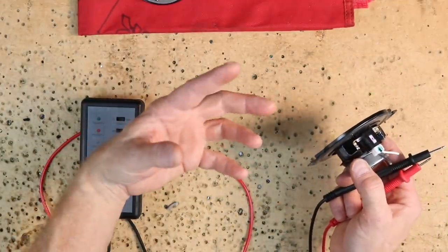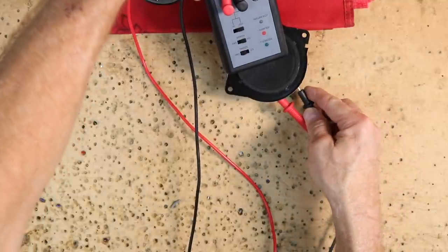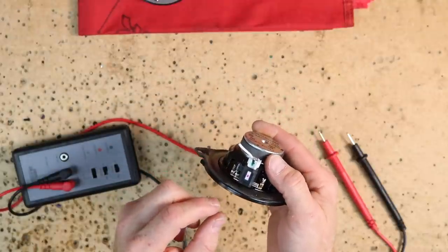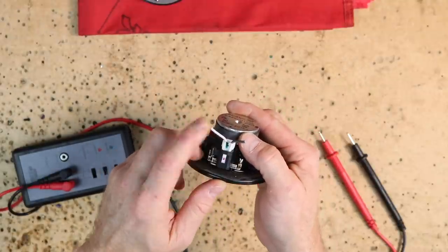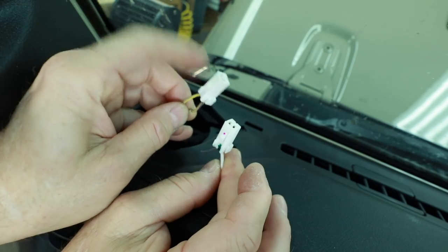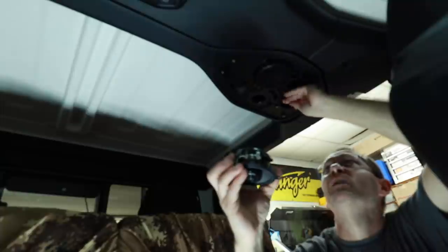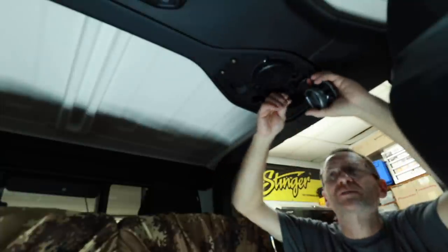These speakers have to be hooked up properly — we need to know which one is positive and which is negative, and we're not going to hook them up backwards. It's the radio signal output that is changing, not our wiring. We're getting a red, now we're getting a green. Looking at the speaker, the side with the capacitor is the negative, the side without the capacitor is the positive. In the rear, the black wire is positive and the white wire is negative. Once you know one speaker's polarity — and since all these speakers are identical — you can apply that to any of the other speakers in the car. So for the front speaker, the gray-yellow is negative and the gray-purple is positive. We've added a big positive and a small negative terminal using fully insulated terminals.